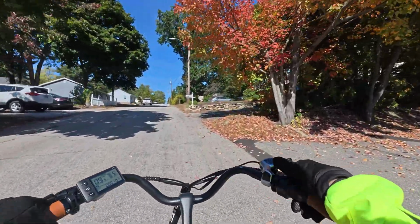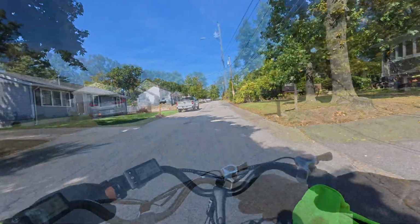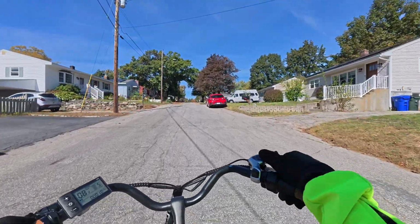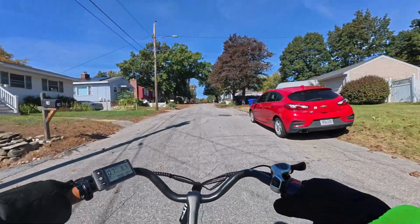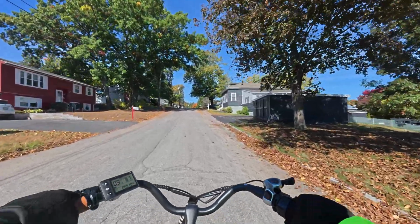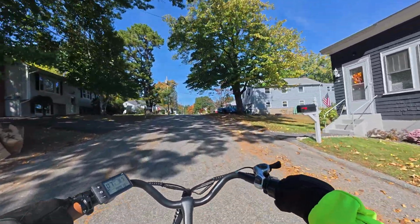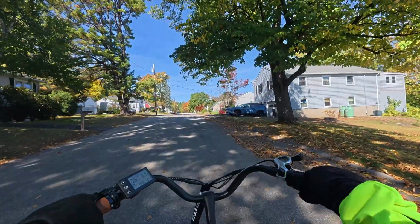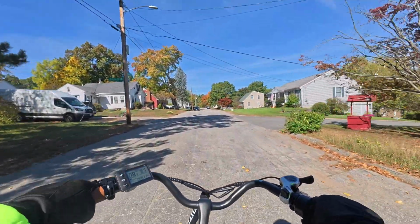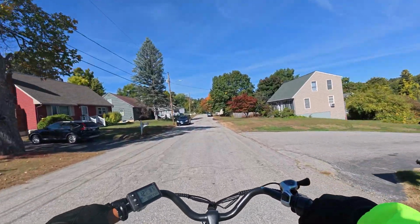And this is a pretty good hill here. I dropped it down to first gear and I'm doing 8 miles an hour. But even with 2 battery bars, it's maintaining. This hill is 12 degrees. I know that because I have checked it before. And again, we're in pass 5, 7 miles an hour, 2 battery bars, and we're going up it. Let's try throttling. 7 miles an hour, 6. It made it though. And we've crested the hill now, and now it's picking up speed. I don't know if it would have throttled from the bottom, but it throttled halfway up.